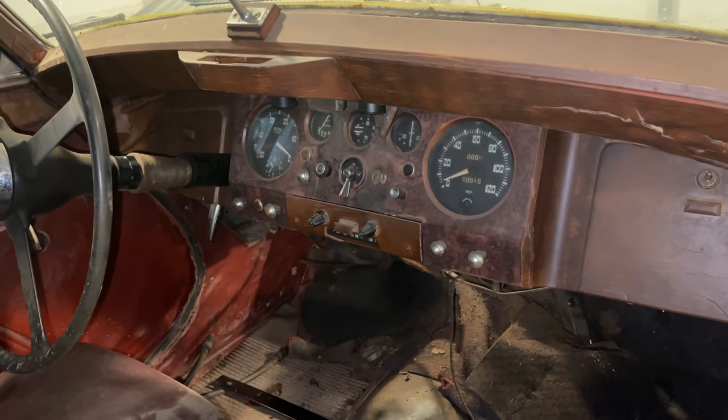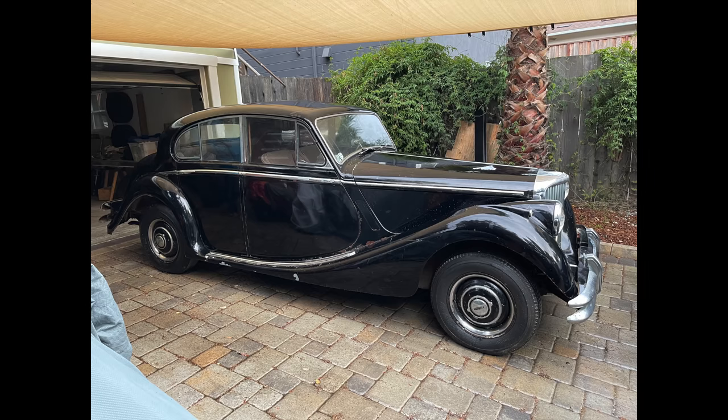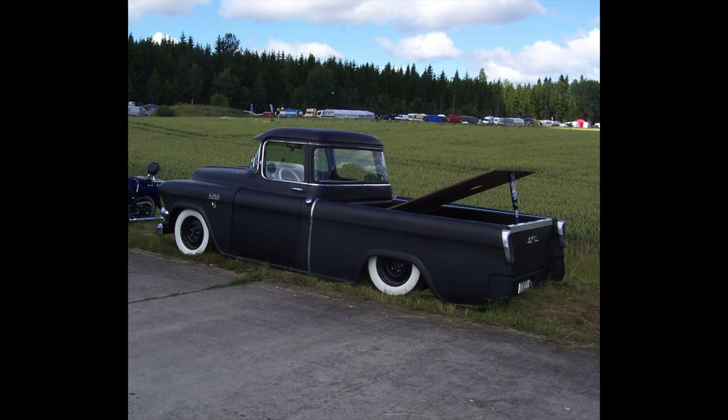I would love to make this car comfortable enough to daily drive. I'm going to replace all the seals, add some sound deadening material, and put in comfortable seats. I'm probably going to add air conditioning because I need to put an AC pump in anyway to keep the motor and battery cool, so I might as well use it. Then I could add a PTC high-voltage heater — it should actually be pretty easy to make it a nice comfortable daily car. I'm not super sure what I'm going to do with the paint, but I'm kicking around the idea of going for an American car style from this era — chop the top, flat black paint job, shine up the chrome. But most of that comes later. First things first, we've got to get the powertrain in and get it driving.